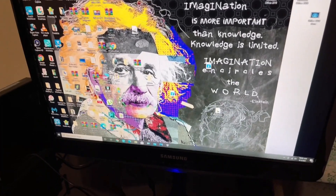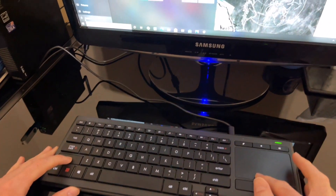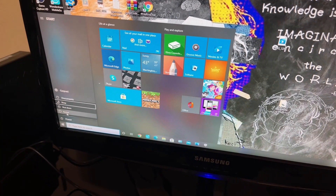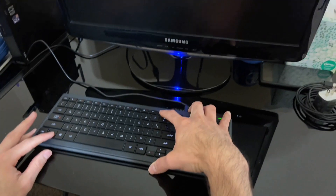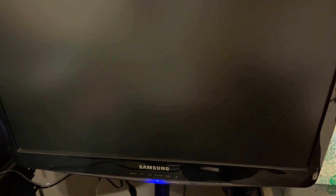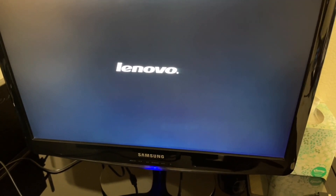If you go to your Windows logo and click on it, if you installed Windows 10 as an upgrade you can hold down Shift, click Power, then Restart — that'll get you into the boot from USB settings. For me, since I installed in legacy mode, I'll just shut this all the way down and restart it to boot from USB. I'm going to hit Fn + F12 to boot into my USB. The only reason I have to do it this way is because of legacy mode; anyone who installed Windows 10 as an upgrade can just Shift + Restart to get into the USB menu.